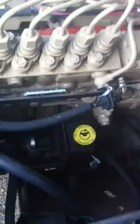Over here, something I like to show everybody. It's all fully mechanical. Throttle. That's the Ford F350 5.4 throttle cable. I just modified it. Built me a B-nut here, something I learned while working on aircraft. Making these B-nuts makes them a little easier, or more dependable than what you would buy. Same thing here for the shut-off. It is manual shut-off. There's no electric on the shut-off part of the engine.